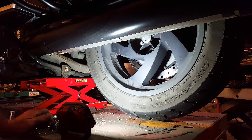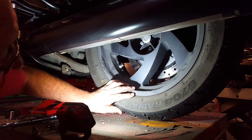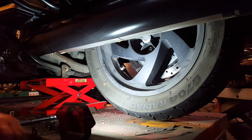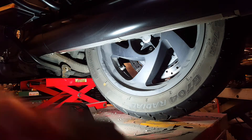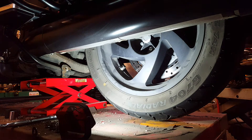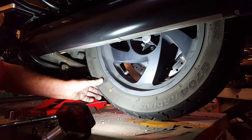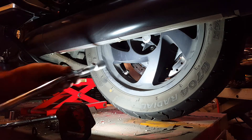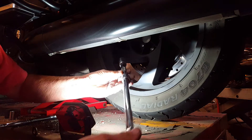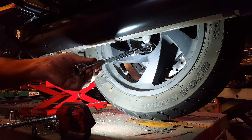This is one of the deals I ran into on this bike. I usually don't run into this on the Gold Wings too much. I've got an electric impact wrench — Milwaukee half inch — which puts out 180 foot-pounds. Typically when I take the wheels off I got a lift here, so it's really easy. I throw an 18 millimeter socket under a 6 inch extension and a 12 inch and they usually spin right off.